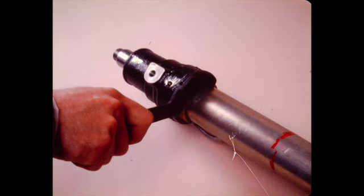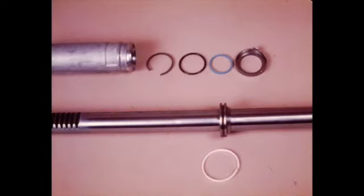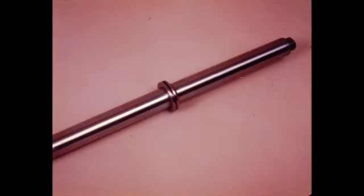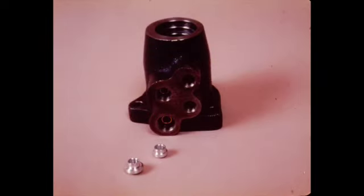When removing the end housing, use tool S355 or equivalent C-spanner to release the ring nut. Tap out the end housing retainer with a drift pin and remove the seal and O-ring. After disassembly, carefully remove the inner sleeve split bearing and the rack piston ring. The piston ring is reusable — do not discard. The pinion shaft upper seal can be removed after removing the circlip and the seal retainer. Discard all seals and O-rings. Thoroughly clean and inspect all components and check for surface damage or wear. Polish any minor rack bar scuffing or varnish buildup with oil-soaked 500 grit paper. If necessary, replace the pinion housing port insert seats.